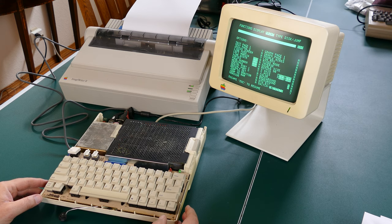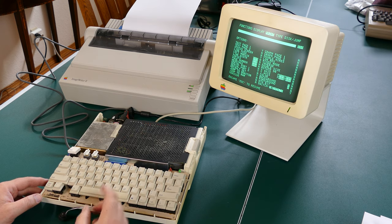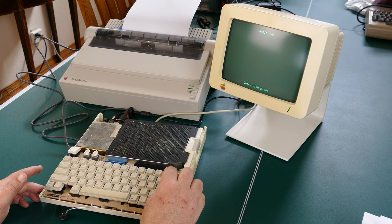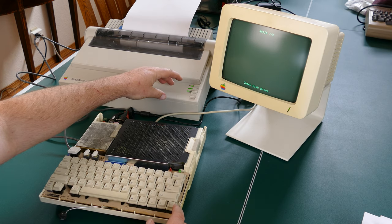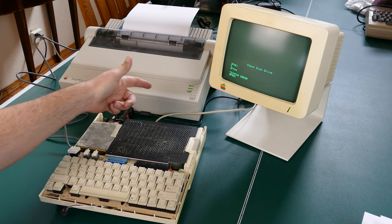Let's turn it on and see if anything happens. There's the Apple IIc — now if I hit this button... oh cool, look at that! There's a display showing: print, type, disk. It's actually working — the whole problem was just that button. This is really cool. It's got the left margin and all kinds of settings for your printer. I just want to print this and see if it works. But I noticed the status light is not on on the printer. Let's turn the status light on — there we go, now it's working. It seems like you have to be careful about the order you turn these on — make sure the status light is on before it'll start working.